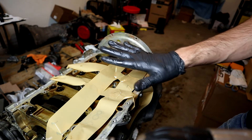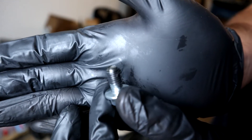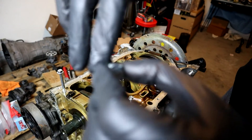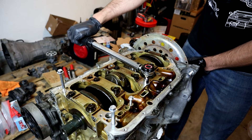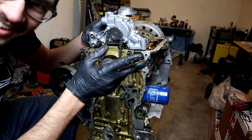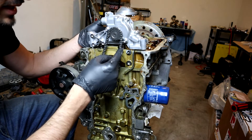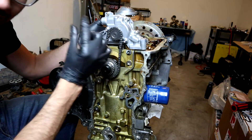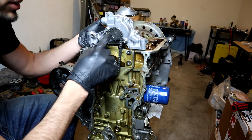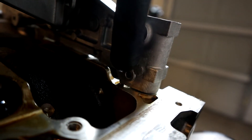Just enough on the threads — didn't have to be a crazy amount. That was literally a hundred times easier with one or two extra links. I'm assuming this chain is made to fit this oil pump, as the gear probably sits about four millimeters higher than the stock one. You can see there's a slightly raised edge on the block that is preventing this from sitting down all the way.